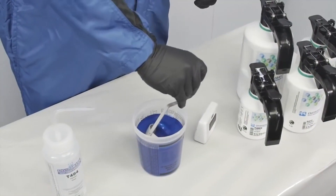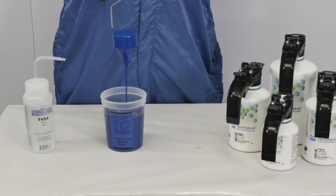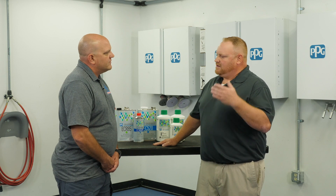And then of course, viscosity — that's one of the main things we always focus on. We want that down in the 23-second range, or the bottom of the actual viscosity range. We want to understand that if we spray four coats in a really hot and humid or extreme condition, it's still probably just as fast as three normal coats. So we want to put a thin coat down, flash it off fast, and get out of the booth so we can move on to the next job.